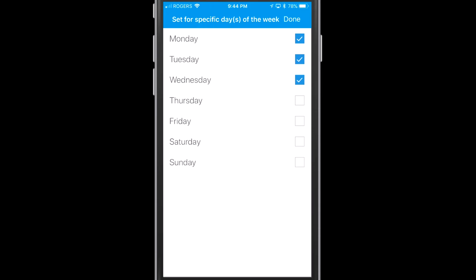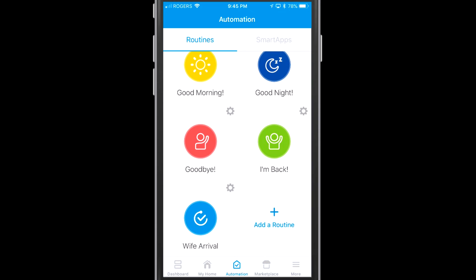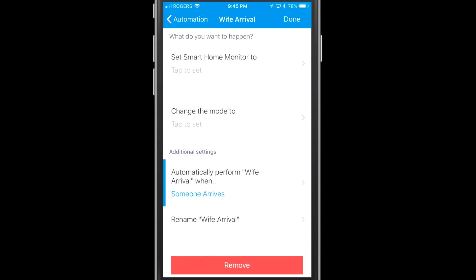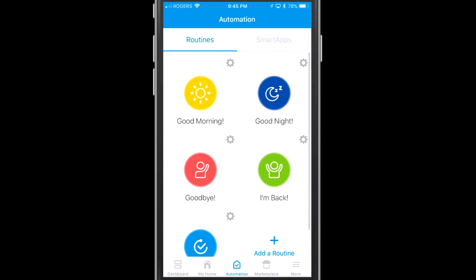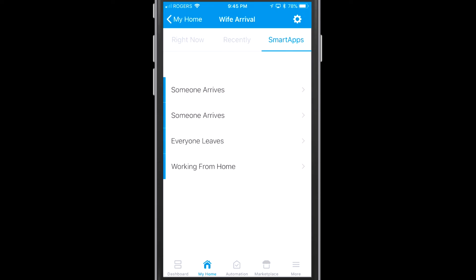Obviously that's only going to be valid on weekdays. Once I've done that I'm going to get that text message on any one of those days of the week when that arrival sensor is still at home. The other reason that's important is because my security system is going to be turned off — I want to know about it. If my wife has just left her arrival sensor at home then I can go into the Samsung SmartThings app and simply turn that back to armed. Your arrival sensor is now fully integrated into your home security system. Whenever you take that device and leave the home it's going to trigger your security system, and I've put it in my wife's vehicle to make sure that whenever she leaves with that vehicle the sensor is out of the home.